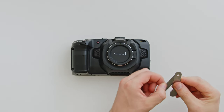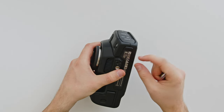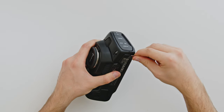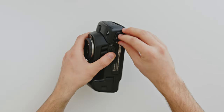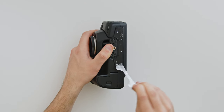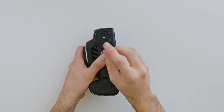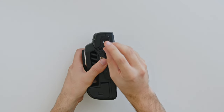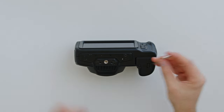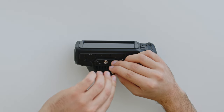Using the scalpel knife again, remove the sticker from the base of the camera. This is a little tricky to do without damaging the sticker, but you don't need to worry too much about keeping it anyway. Underneath that sticker you'll find four Phillips head bolts, which need to be removed with the smaller Phillips screwdriver in your kit. Back on the T6 Torx allen key again, to remove the four bolts holding this black metal part around the camera's quarter inch thread.